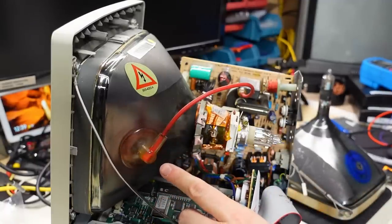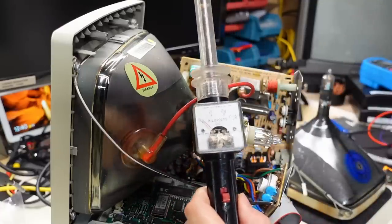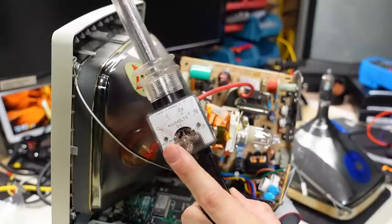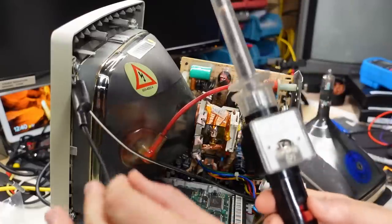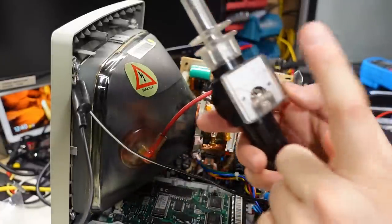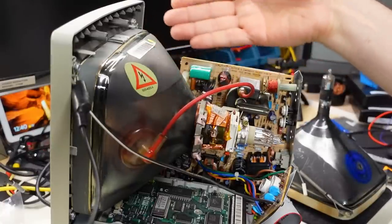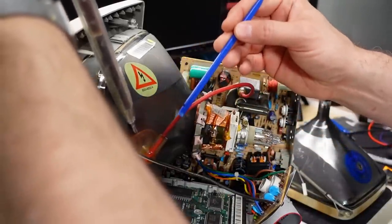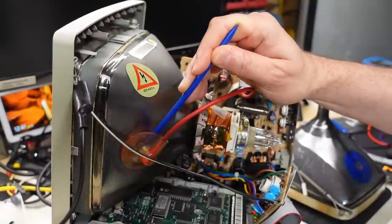I'm not going to talk about the right or wrong way to discharge the CRT — there are lots of how-to videos on the internet. Personally, I have this high voltage probe here, which is designed for measuring high voltage while the CRT is running. It also has a really good ability to discharge the CRT if there's any stored charge. I connect the lead from the bottom of the handle to ground, then stick it under the anode cap, which has the effect of shorting out the capacitor. I'll know if there's stored charge because it will register on the meter. Absolutely nothing was read — no voltage registered at all — which meant the CRT was already discharged.